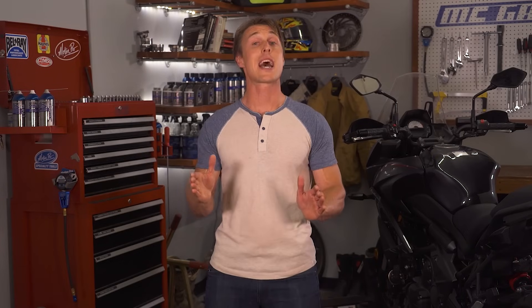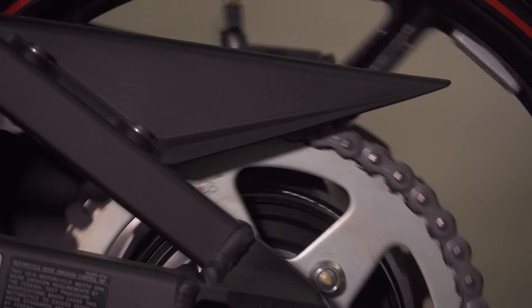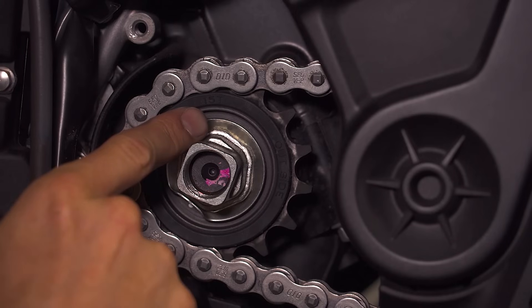The good news is that while crunching the numbers and looking at the actual gear ratios is helpful, it is not actually necessary. All you really need to know is what the tooth count on your motorcycle is right now, and that is usually printed right on the side of the sprocket. Then you just have to figure out how you want to change the tooth count in order to change your bike's performance.